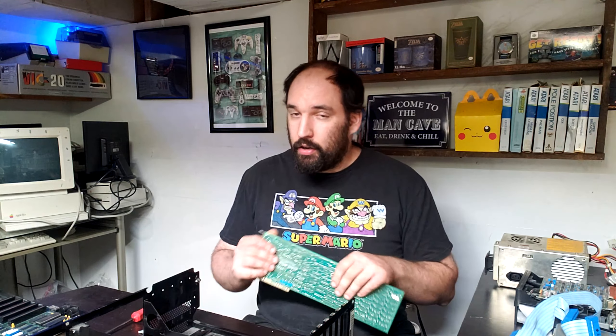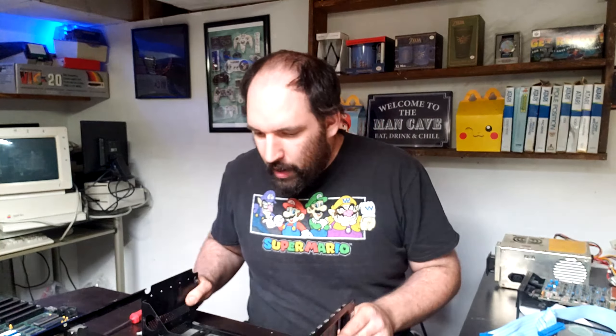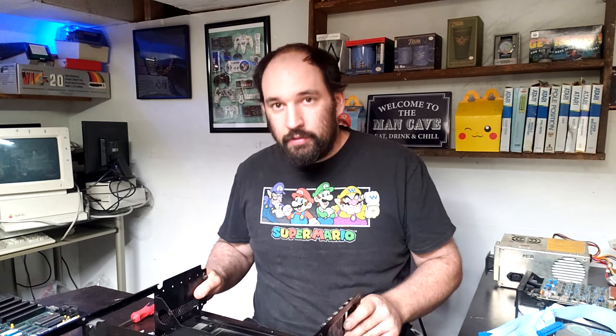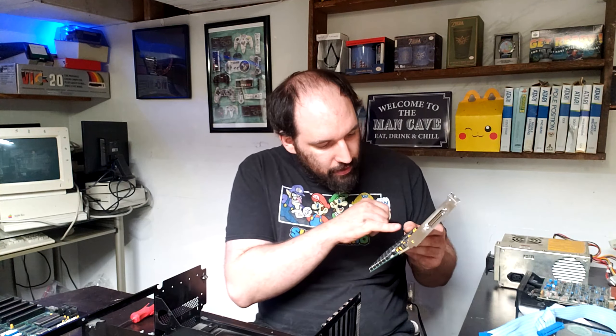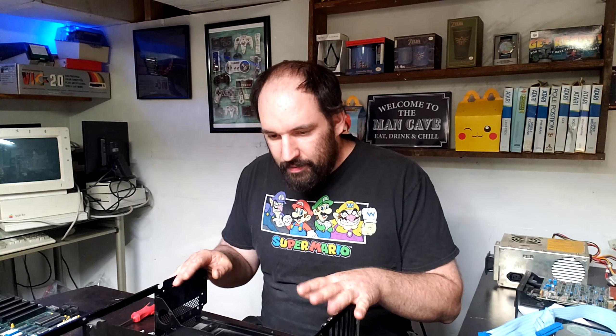He said he wouldn't be surprised if there was a piece of electrical tape or something from where he stuck the battery to the hard drive. But I don't see any tape residue, so it may not have stuck well. He cut the battery off because it was basically dead, but it might have also started to leak because there is a tiny bit of corrosion on a main trace here. We're going to have to look at the board carefully.